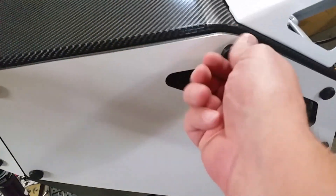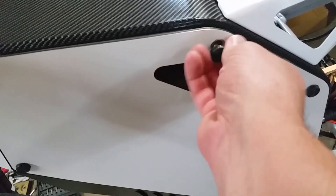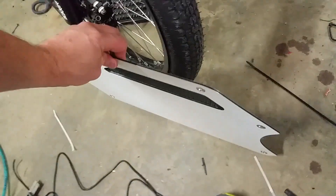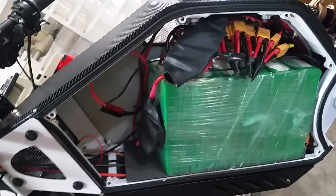It's just thumb screws, so we'll take all those off. The side cover comes off, and there's your battery pack. This is your BMS unit here — that balances your cells. This is the custom wiring harness. You'll see numbers: 5 to 8, 9 to 12, 13 to 16, 17. Those are your battery bank cell portions.